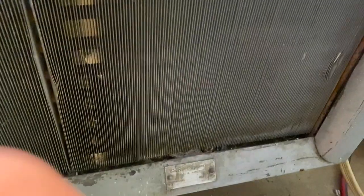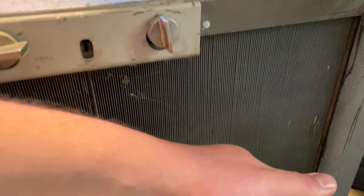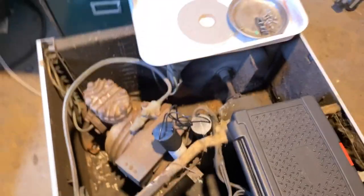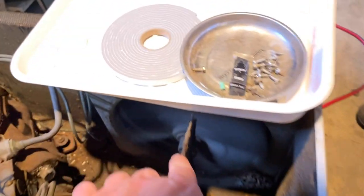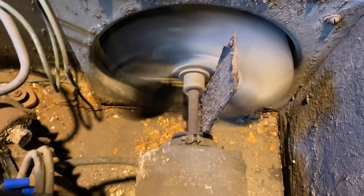Even that makes the fan motor sound loud, I know. They just make these units today to run for the money, as far as that goes. We have to put the lid on here — you've got the caps kind of sticking up. You have to source out the proper capacitor — this should run good then. It's a big start cap; we probably just didn't have enough microfarads. I wonder what the purpose of this piece is — might be to keep the lid from caving in on the fan.